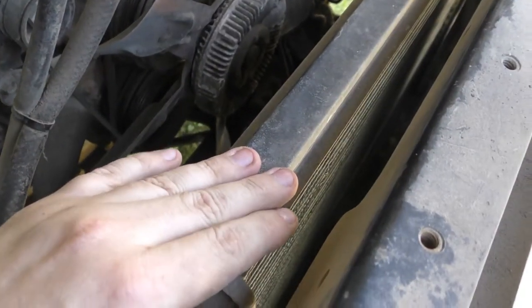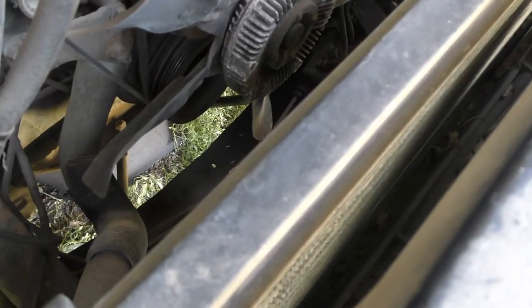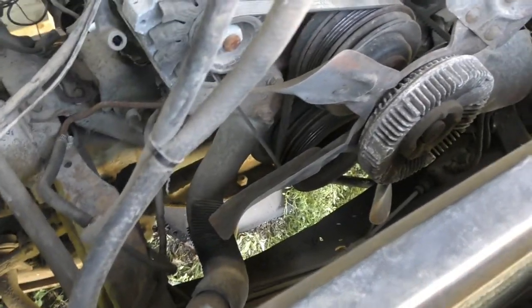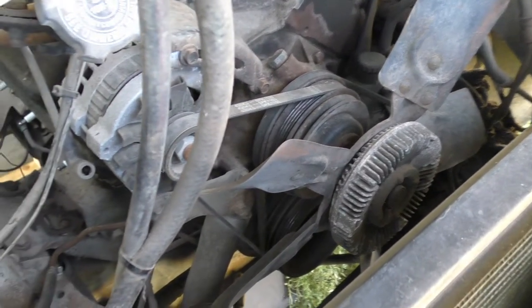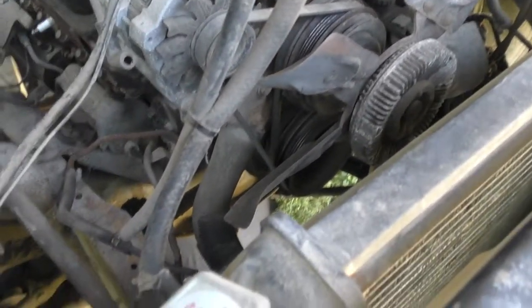Right in here we got an old radiator. This is something that was just pulled out of the back junk lot. And then we got our standard clutch fan — no shroud. That got annihilated quite some time ago. So the first thing we're going to do is rip out our radiator. We've got our bucket down here and we'll clean this thing up. The big reason we're getting rid of this radiator is it doesn't have the provision for heat. I've been running this thing without heat for a good 10 years, maybe more. Can't remember when I bought this thing, but it hasn't had heat for quite some time. So we're going to eventually remedy that — probably get a little bit of heat and air conditioning. Really live high on the hog here. Anyways, a couple screws and we'll just yank this thing right out.